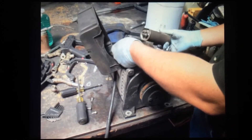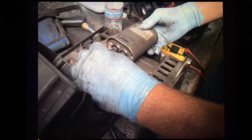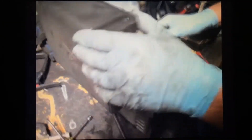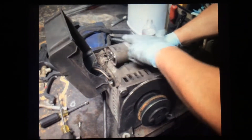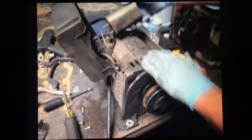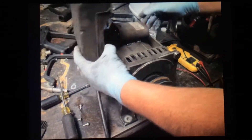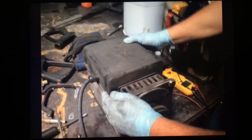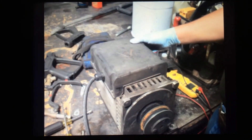To reinstall this, it's the reverse of taking it apart: reattach the leads back onto either side of the capacitor and put it back in its original location. Some of them will have a piece of tape across the top or a piece of foam to keep them from vibrating — if that's there, we want to reinstall it. In this case it's not there, so we don't have to. Lay it back in its original location, line up the cover, reinstall the screws, and we're done with that capacitor.